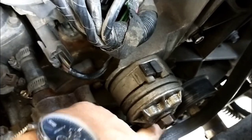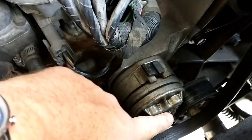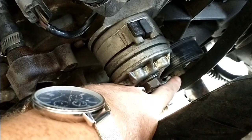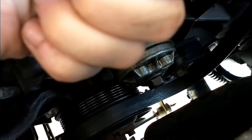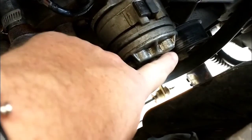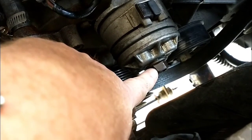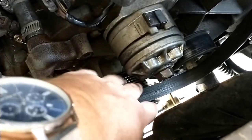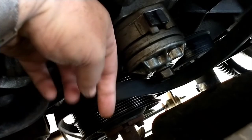Taking the other belt off — you can see right here, this is the tensioner. It's got two parts: this part and then the pulley. To take it off, you put a ratchet on there and pull it up. You have to pull really hard. If it's not budging at all, you might have to crack this nut just a little to relieve some tension — not very much, just break it loose a bit — and then pull, and that belt just slips off. You just have to weave it around the fan blade to the front.